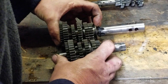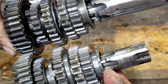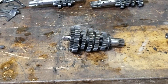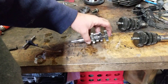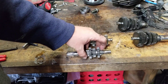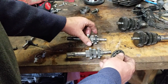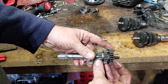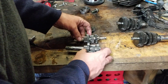When we pull it back, we can see the retainer is in the same spot. One uses a clip, one just has the banks — those are the same. With that done, let's check out the input shafts. Here is the G4 one and here is the G5. You'll notice the gear is missing on the G4 — because this gear right here slides right off the end and will slide right onto the G5 shaft and work the same. It will lock right in. So we'll take that gear off since we know it's missing on the other shaft.